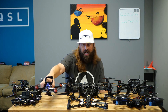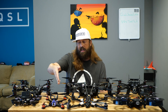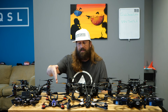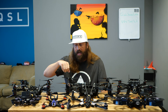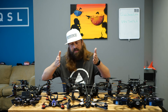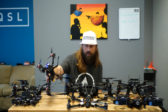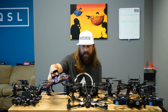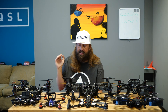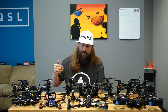I've also got here the Shrout Law, which is a custom build we do and only we offer. It's a frame designed by Andy Shin, actually designed for Area 51. John Shrout had a lot of influence because he requested this specific layout — a stretched and squished X long ways — which allows for a super lightweight frame. It's really one of the most lightweight builds we do, especially with DJI. With a high KV 5-inch motor on 6S, this thing is doing 100 to 120 miles an hour chasing things around with ease. It's a really, really lightweight platform.